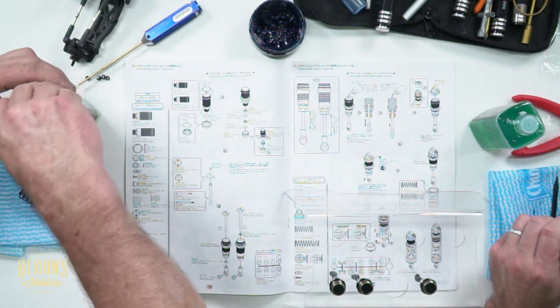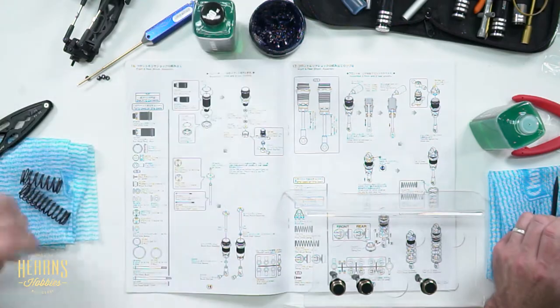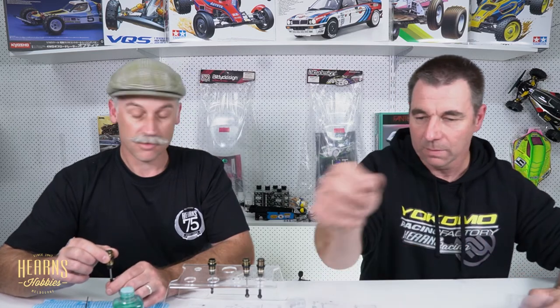There's no point rebuilding them the night before if you're racing in the middle of summer. No, because of the temperature, bleed them at the track. They'll build temperature once the heat comes up. So if you build them the night before, you're better off to pack them with no springs on them, compressed. Yeah. And usually bleed them throughout the day anyway, no? Because I usually pack up if the weather's... Yeah, if you could be bothered.